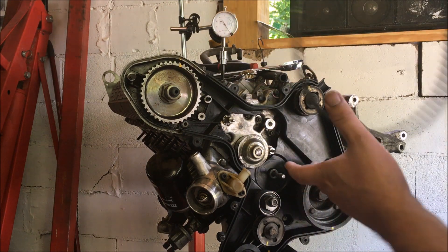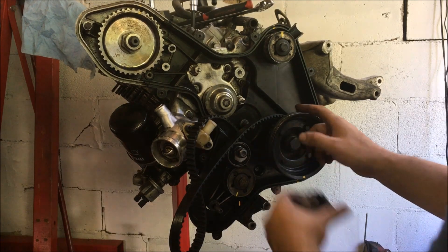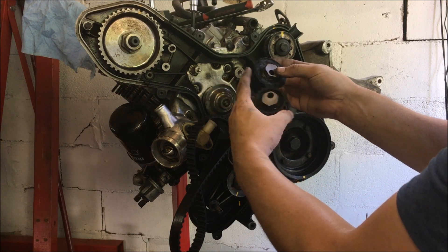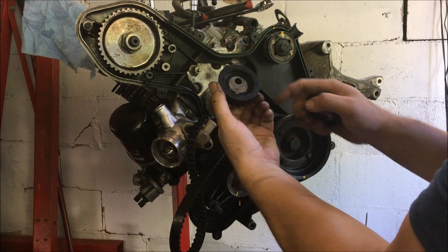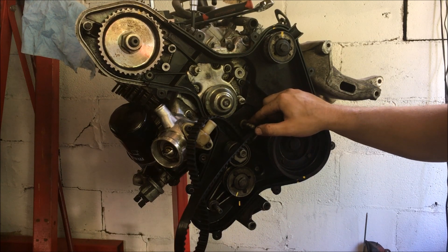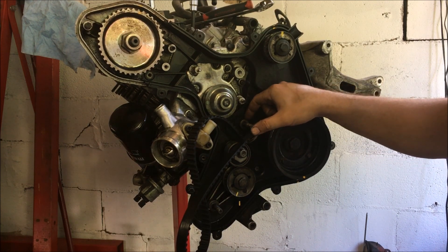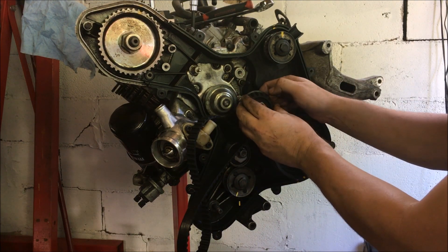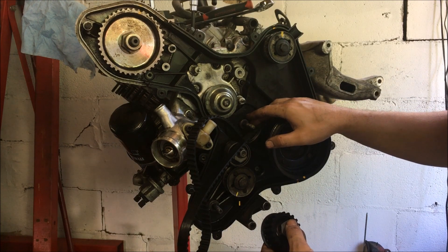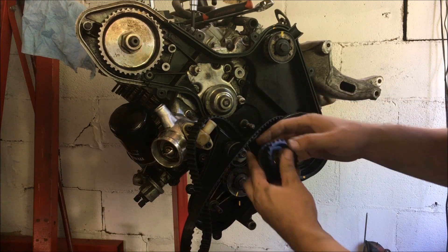I have the belt here and I'm going to go ahead and get it on. The first thing I've done is put the belt around the crank sprocket down here at the bottom. Next I'm going to be installing the tensioner. If you have an early car like this one, pay close attention that you don't mix the tensioner up with the balance shaft tensioner which has the flange on the front — you want the timing belt tensioner to have the flange on the rear. Also, early cars have a boss that protrudes from the belt cover. If you put a later oil pump in an early car, this boss is going to sit flush with the cover, not giving enough space for the tensioner, and you'll end up breaking the tensioner. Make sure that this boss is protruding from the cover before installing.